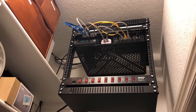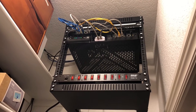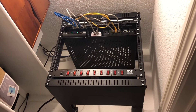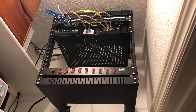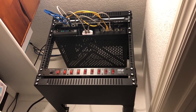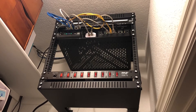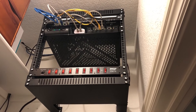Here's the finished product. The cables didn't turn out nearly as neat as I'd hoped — however, I haven't purchased any additional ones really either. I could spend a little more money and get some really short cables that would be the exact correct length; I may do that later. I have one thing that's Power over Ethernet right now, and I plan on adding an additional PoE switch if I add some PoE cameras. I may use a special color like red to designate anything that's basically hot, so I don't plug it into something I shouldn't. An additional 1U switch may go in.